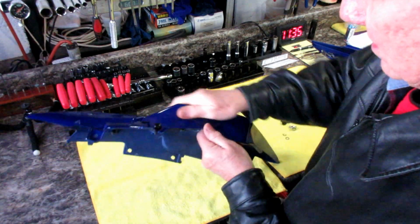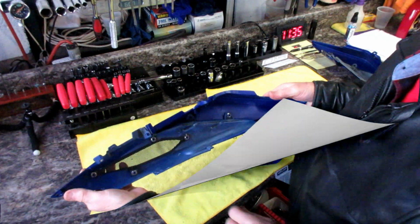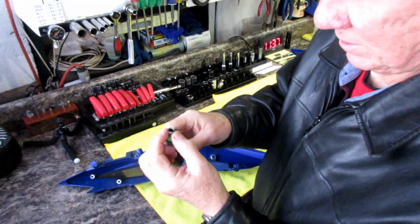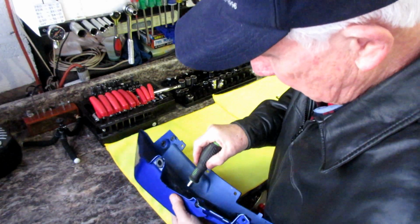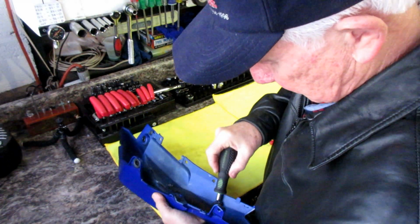It's almost impossible. This way works best. Put the 2 pieces together and put this on as a unit. And this is a really good tip. This is just a socket that goes around these little press nuts, press washers, whatever you want to call them. And when you think you got them all in place, this will just sock them up if you press it on. It's a nice little way.